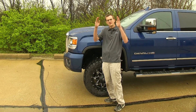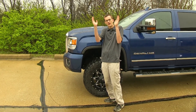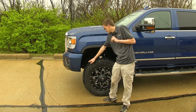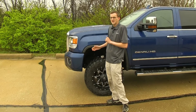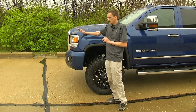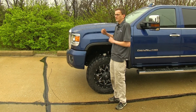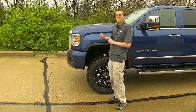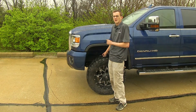Our front tires are starting to camber out — this is called positive camber, which will cause more tire wear on the outside edge of your tire. All of these things combined mean we could blind incoming drivers with the headlight angle pointed more in their face versus down towards the road. We'll have decreased handling, decreased stability, decreased braking ability — all in all, not a safe ride.